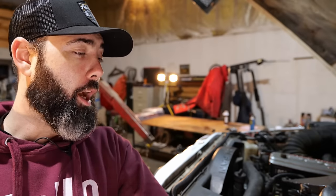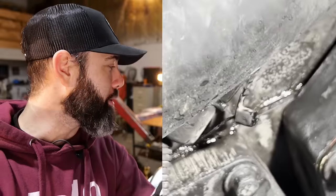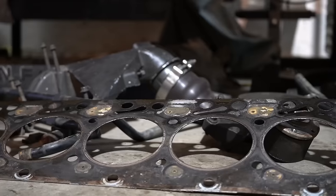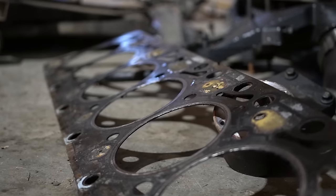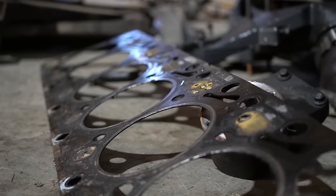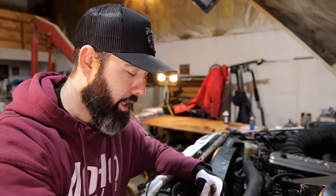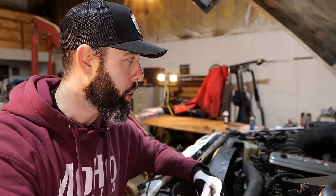The last job was supposed to be a nice easy one — it's not looking like it's going to be easy. I really wanted to identify where I was leaking oil from and was hoping it was just going to be a vacuum pump or something like that. It's not. Looks like we have a blown head gasket. We got really lucky — there is no cross contamination, no oil in the coolant and no coolant in the oil. It's just pushing oil out the front and maybe out the side, or maybe I have to deal with a tappet cover gasket as well. That's my unfortunate news and it's gotten in the way of some further travel plans this winter. But it's got to get done because this summer we're going so remote this truck has to be rock solid.